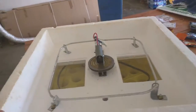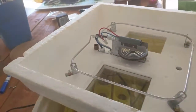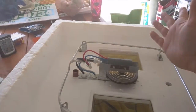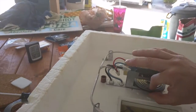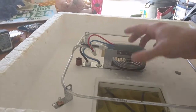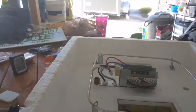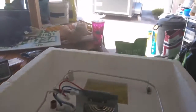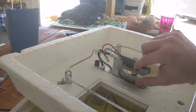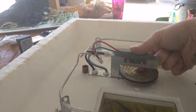We had a lot of problems with this thermostat not being as precise as it should be. It's called a wafer thermostat — it's a mechanical unit, very simple, lasts forever. There are two wafers here; each one is filled with a gas. That gas is very sensitive to temperature changes — warms up a little bit, expands a lot; cools off a little bit, contracts a lot. That gives you a very tight tolerance of temperature. As it expands and contracts like an accordion, it actuates a switch.